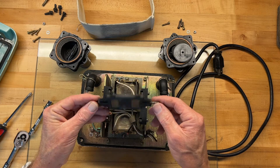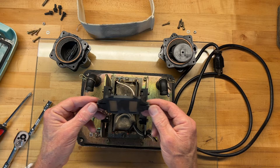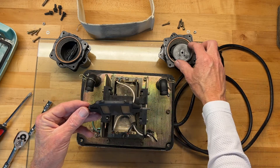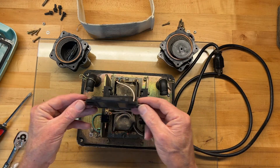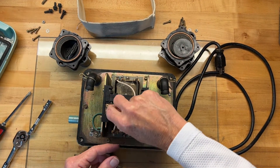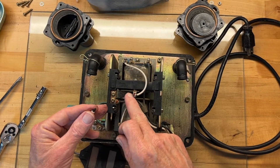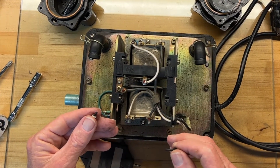I'll clean this up a little bit. You'll see a tab sticking out the top. The way this works is the shuttle oscillates back and forth and pumps the diaphragm on either end alternately. But when a diaphragm fails and tears, it lets the shuttle move too far, and when that happens these tabs break this small plastic screw. When that screw breaks, the contact comes free and shuts off the power — preventing the unit from tearing itself up.